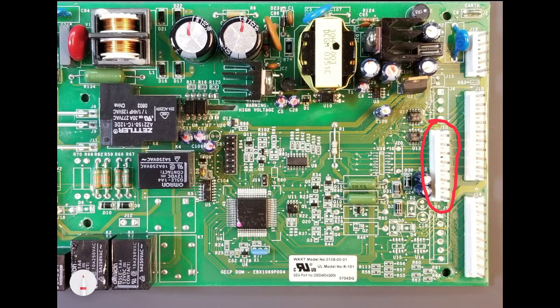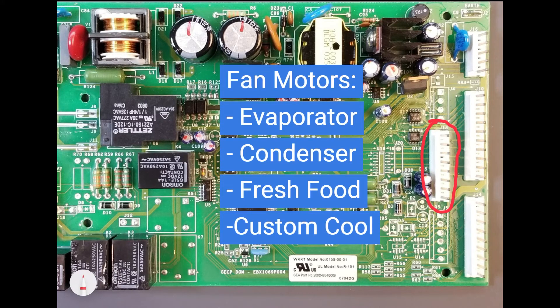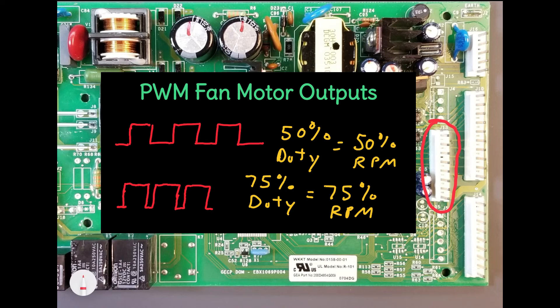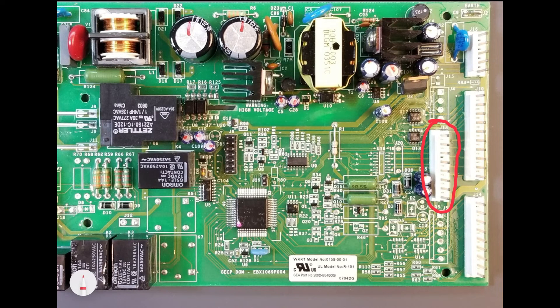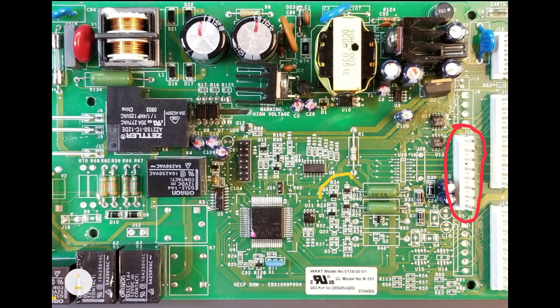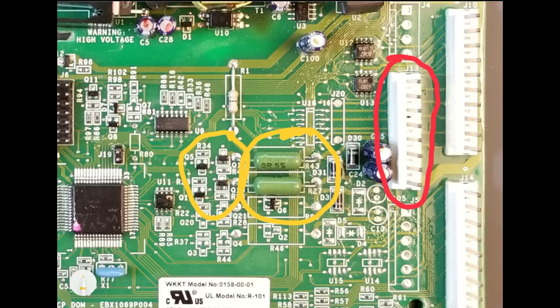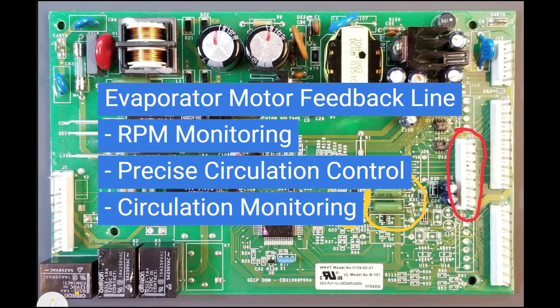This connector is designed for interfacing with pulse-width modulated DC fans. It supports multiple fans, including evaporator, condenser, fresh food, and custom-cooled DC fans, depending on the model. The connector provides a 12- to 13-volt DC output to power the fans, a common board ground, and four PWM outputs. The duty cycle of each PWM signal, controlled by the microcontroller, determines the speed of the corresponding fan — higher duty cycles and thus higher average voltage outputs result in higher RPM. These PWM signals are only 5 volts with low current capability, so they are buffered by transistors which increase the current output and allow for 12-volt operation. Power resistors are placed in series with the PWM signals for the evaporator and condenser fans; stressed or overheated power resistors often indicate failing fan motors. Additionally, the evaporator fan features a feedback line that allows the microcontroller to interpret the RPM and fine-tune its speed control for more precise air circulation.